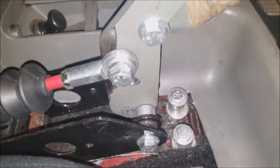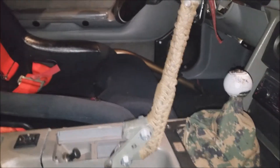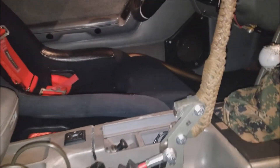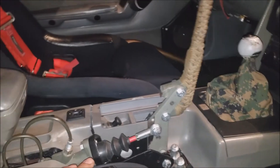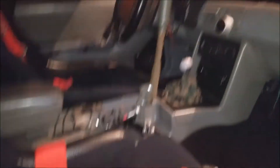I've got to get this out of here and weld up a new bracket. I'm actually gonna install it at an angle so that instead of the pull going straight back it's gonna pull towards the driver a little bit, which is more ergonomic and more efficient. In order to get at this I'm going to have to pull this seat out again — I didn't tighten it all the way down because I knew I'd be pulling it right back out. Four bolts, just like before.